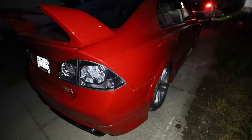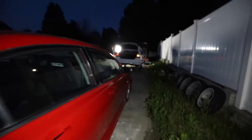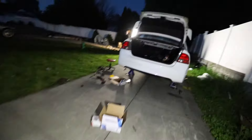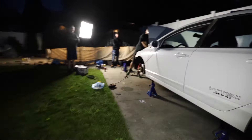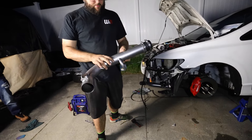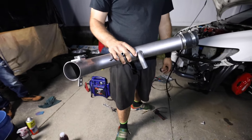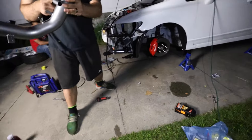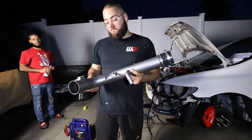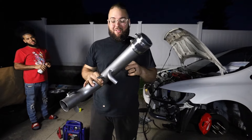Angel's car is running, we just got to finish it. He got new seats too and the big brake kit installed. We need to block off the Tial fitting, and then most of the vacuum stuff on the manifold is not even being used. Some of the lines can get cut off — this one recirculated back and isn't needed anymore. The two smaller ones: one is for the breather.